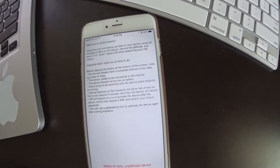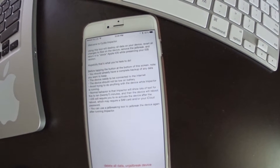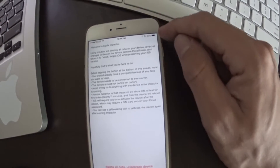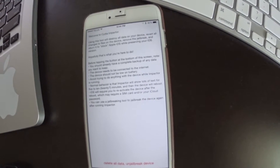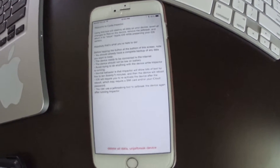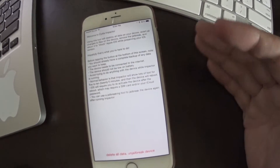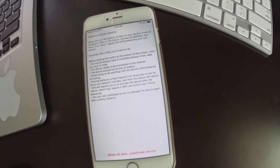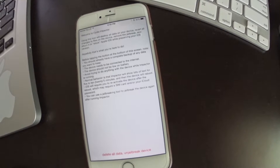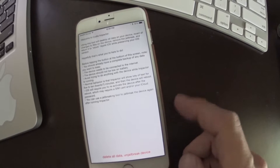When you tap the bottom of the screen, know that it's going to delete all of your data. You need to be connected to the internet, you should not be on a low battery — I'm at 80% so I'm okay. You need to avoid doing anything on the device once this begins — leave it alone. You will see a lot of text going on and it may seem to freeze; just leave it. You will need to reactivate the device after, so make sure you have a SIM card.